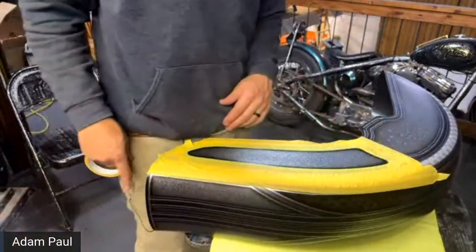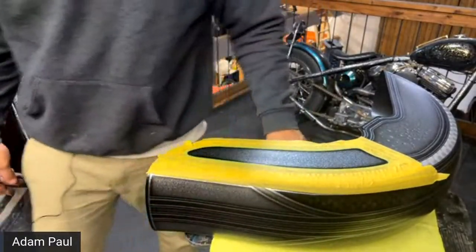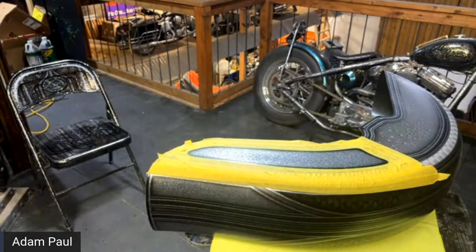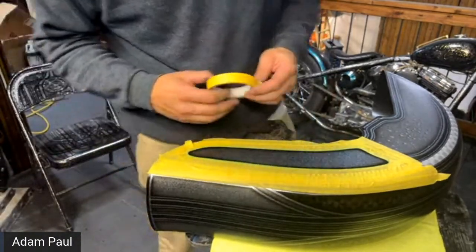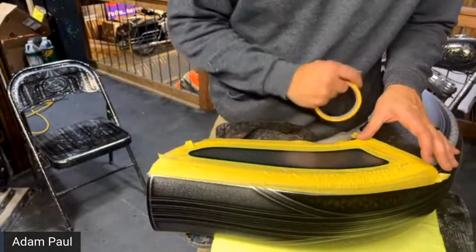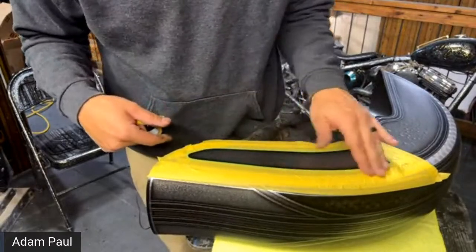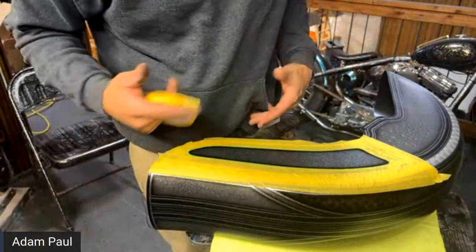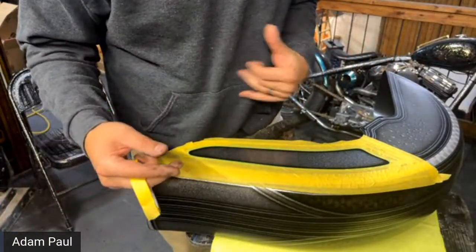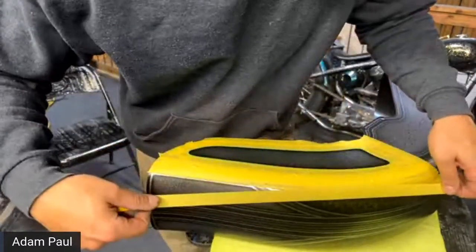Someone said, I heard there's different size flakes. What's easier to use? The easiest metal flake to use is the Limeline for sure, because it's sprayable rather than having to buy the extra equipment to blow it on dry, which creates more texture and more work. The Limeline's the best. It sprays on easier, it buries easier. You can see that it has a ton of sparkle. Just because it's a smaller flake doesn't necessarily mean it's not as sparkly. It's actually the exact opposite.